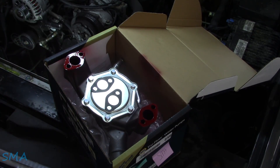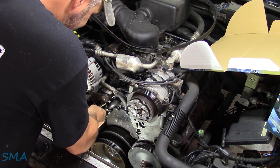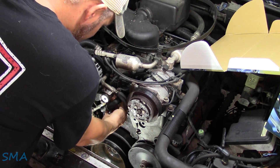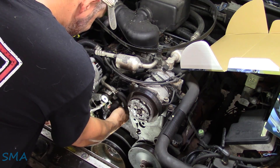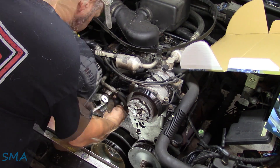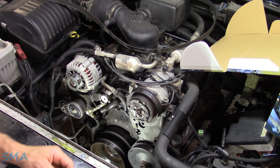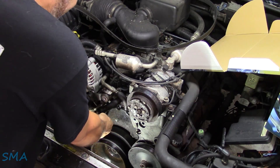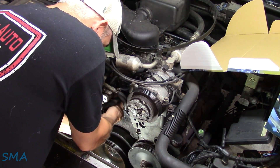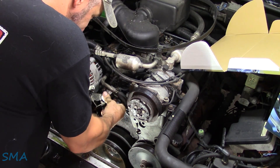Like my jokes. Then we're going to use the paper gaskets — stick them babies down. We're only spraying one side, just because when this goes bad it's a whole lot easier if we don't have to scrape all the crap off the block like the last guy did for us, which was super nice. Stuff only takes a little bit of time to dry — 30 seconds or a minute; the thicker you get it the longer it takes. While we're waiting for that to tack up, we're going to swap out this hose right here that goes from the intake to the water pump.